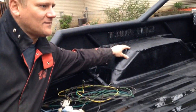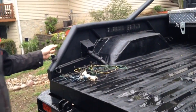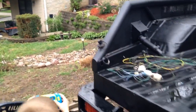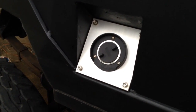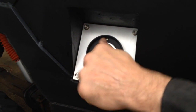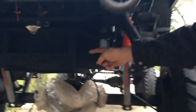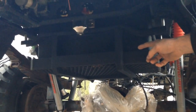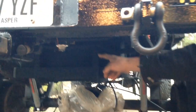I cut down the stock fender wells, pounded out the tops of the fenders flat, and welded them back into place. The gas filler is on this side — it's an aluminum marine gas filler — and that goes underneath the truck to a 30 or 32 gallon fuel cell. I built a stout cage around the fuel cell that could basically hold the truck up if it had to, to protect the fuel cell. And then there's a chrome fuel filter.